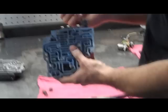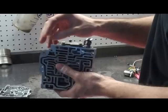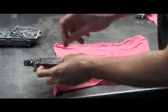Another thing to note is that a valve, when you put it in, has to fall with its own weight to the bottom of the bore. If it's not doing that, it's not free and you have to clean it up some more. Now we put our spring and our end spring retainer. This end cap you kind of have to push in perfectly straight, and when this big hole lines up with the pin, it'll drop in.